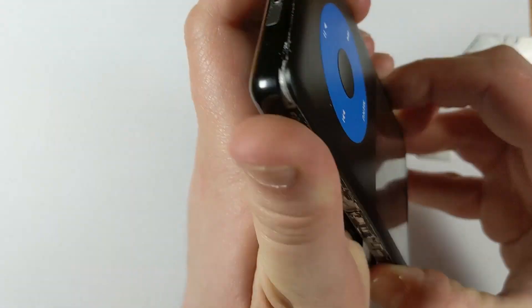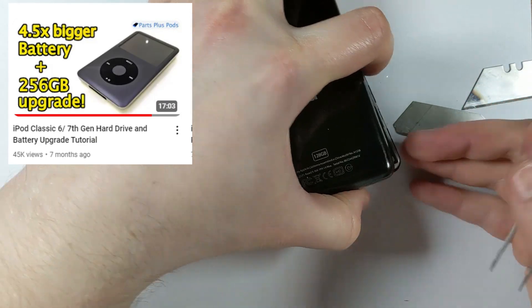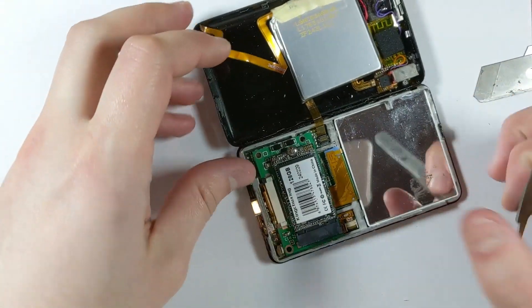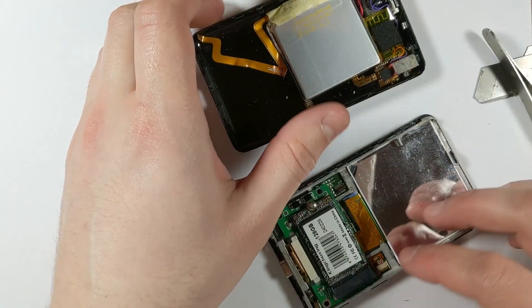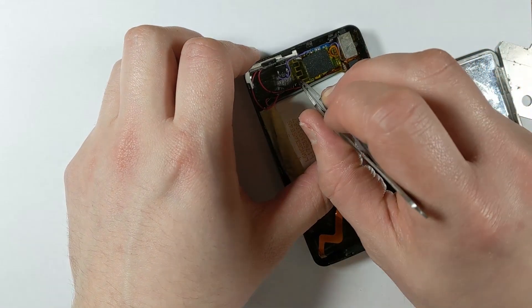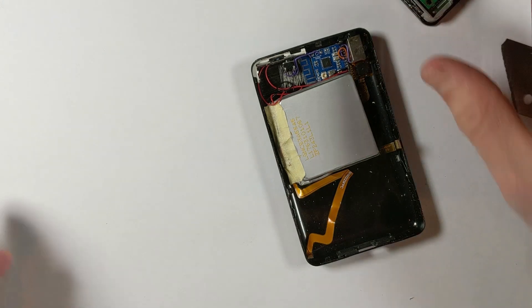First things first, you need to open up the iPod. I'll skip through the process here, although if you need help getting it open without damaging anything, you can refer to my iPod Classic 6/7th gen video where I'll show the full process. Once the back's come off, all you need to do is disconnect the battery flex cable and the headphone jack. As you can see, this iPod already has the hard drive replaced with an M.2 SSD and had a 2000mAh battery installed, along with Bluetooth as well. This was also my first attempt at installing my USB-C kit that I'll hopefully have available soon for both mail-in repair and as a DIY kit, although I still have some more testing to do with that first.